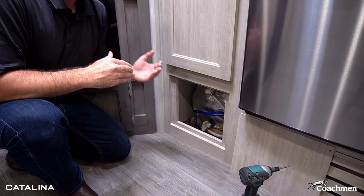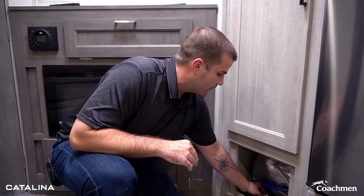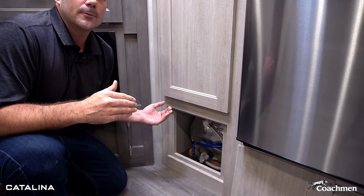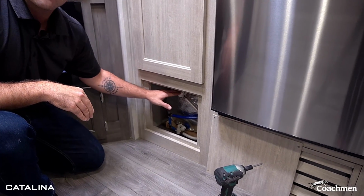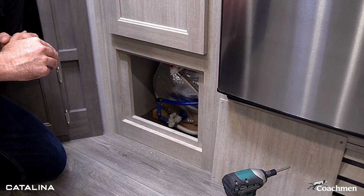But what happens when the camping season's done, we want to winterize it, we want to put it away for the winter. What I want to do is I want to take these valves and I want to point them towards the hose. Pointing them towards the hose, both bottom and top valves, we're going to bypass the water heater for winterization purposes. So we've got our systems hooked up. Chad and Joey ran you through the outside. I ran you through the inside on your appliances, water heater, looking at the power boxes. Now let's enjoy the camping trip, right?